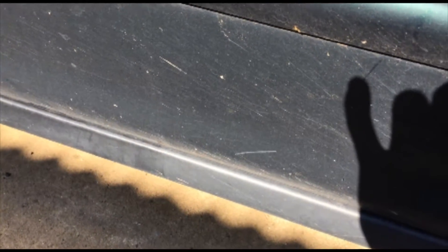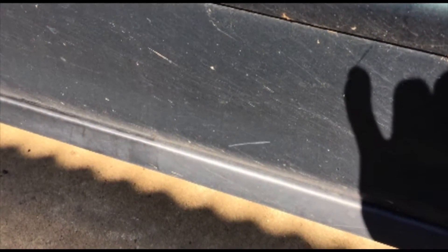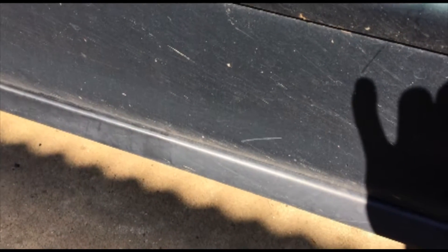Once that's done, don't try to pull the panel straight out because you'll just break the clips. What you need to do is push it this way - once you push it that way, it will fall out and then you can twist off all the clips so you don't break any. I went ahead and removed this plastic panel too. There are two screws - one right there, one right there, and one right there. This one pulls it to the body.